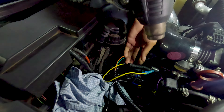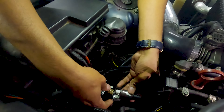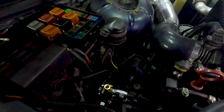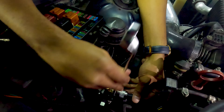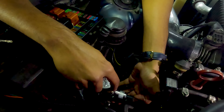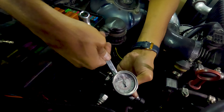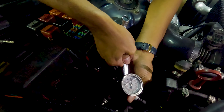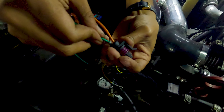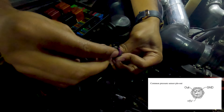The rest of the information on the label isn't really relevant. This is where the T-fitting is going to screw in — gauge on one side, fuel pressure regulator on the other. Very importantly, you'll need to use thread sealer here, but not too much — you don't want it to gunk up inside the fuel pressure regulator and block your fueling system and blow your motor.